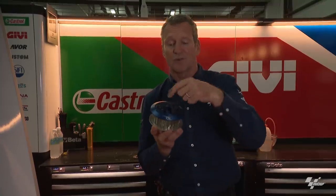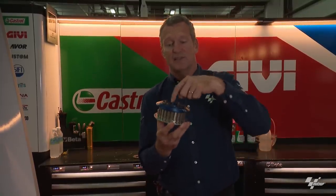They invented the use of an exhaust valve on certain cylinders — like a truck exhaust brake — that closes and causes back pressure, making the engine produce more engine brake. So electronically they can give less engine brake by opening the throttle butterflies, or make more engine brake by closing the exhaust valve when RPM drops low. Everything works together, and the clutch springs must be adjusted correctly to complement this — if the springs are too soft, the clutch opens and you can't build engine brake even with the exhaust valve closed.